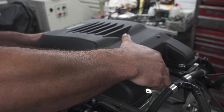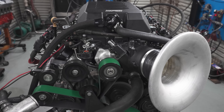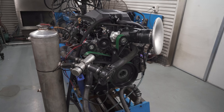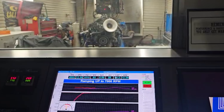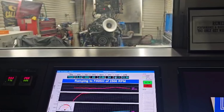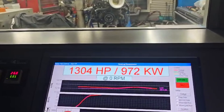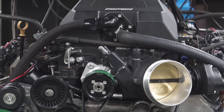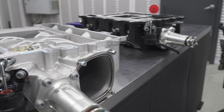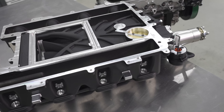Next up was our Race Port Edition with no other changes and the same 3.38 pulley ratio on E85. We ran it up and achieved peak horsepower of 1304 horsepower at 6950 RPM with a decent jump in boost to 26.2 PSI — almost 3 PSI gained over the standard supercharger. With blower speed close to 24,000 RPM, we're seeing a 77 horsepower gain over the two superchargers back to back — a great result highlighting the efficiency of what the RP can achieve at higher RPM.